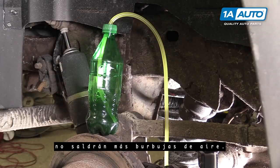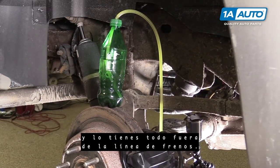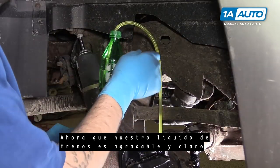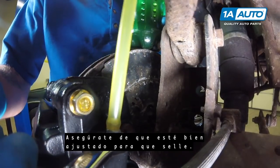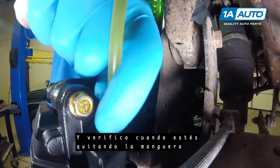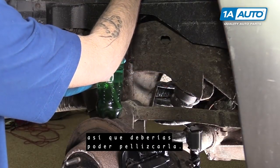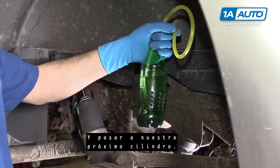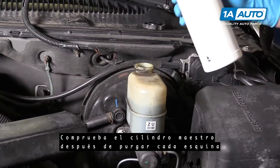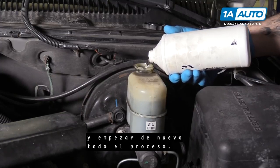After a little while, there will be no more air bubbles coming out, and it is okay to get out of your vehicle and look at the hose. If there are no air bubbles in the hose, then there's nothing coming through, and you've got it all out of that brake line. Now that our brake fluid is nice and clear and there are no bubbles left in our line, we'll close the bleeder screw with our 10 millimeter wrench. Make sure you get it nice and tight so it seals up, and when you're removing the hose, pinch the bottom nice and tight. It is just rubber hose, so you should be able to pinch it off, lift it up, and let go to drain all that fluid back into the bottle instead of onto the ground, and move on to our next cylinder. Check the master cylinder after bleeding each corner of the vehicle because if the fluid runs too low and air gets into the master cylinder, you'll need to bleed the cylinder and start the entire process over.